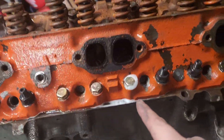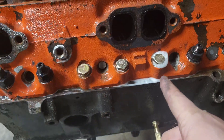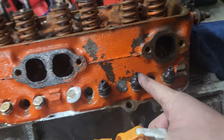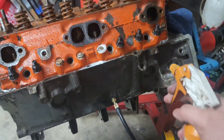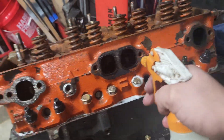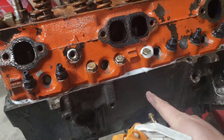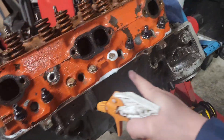It's actually doing a bit of the work for us — you can see there's a lot of bubbles right there. What that means is that the head gasket — well, it's a cheapo garbage one, I didn't expect it to seal perfectly. These three bolts are really short; these are actually main studs so they're nice and long, but if I had longer bolts there, I bet that wouldn't be happening. Anyway, we're going to go ahead and soak this guy down — that's a good example of what we're looking for, a bunch of little bubbles. I'm going to start here on the exterior and check for any exterior bubbles. I would ignore all this stuff right here — this deck has not been worked, it's probably not flat and the head gasket is pretty cheap. All I did was scrape and put it on there, so that's not anything concerning.